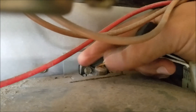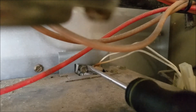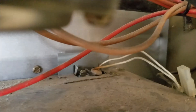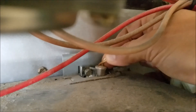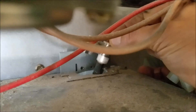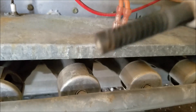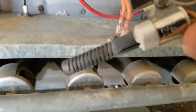You can see there's a notch into that metal plate. These pieces are very sharp, so be very careful. Make sure you unplug the system before you work on this. Once it comes out, you need to pull it away from the notch and then straight up. If you're not sure, be very careful that you don't touch any of the surface of the igniter. I'm going to put this on a clean white table so we can see and diagnose it completely.